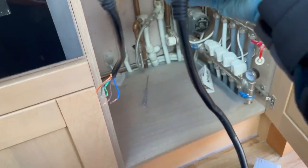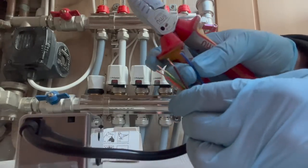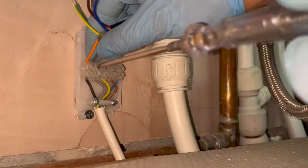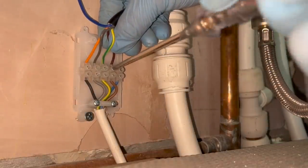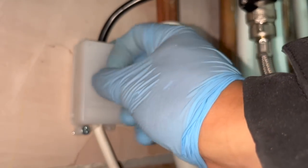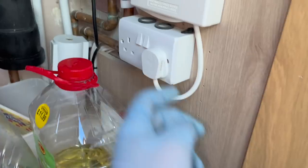Nice and easy because there's a little junction box here - all we need to do is change over this motor and we should be back up and running. Now I'm going to put them side by side so I know how long to cut my new one. And now that that's cut, I'm going to strip it and get the cables ready to go into this junction box. That's all the wiring done. All that's left is to put this little case on, turn on the electrics - already it's not jumping anymore, it sounds much better, so I'm confident it's going to work.